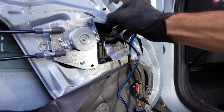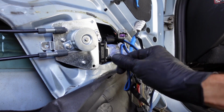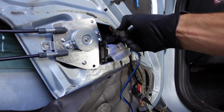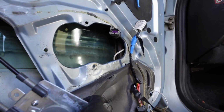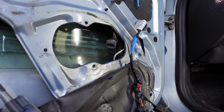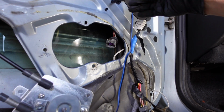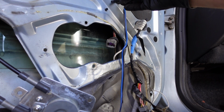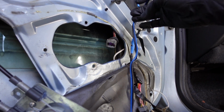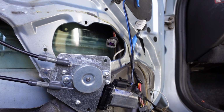Your wiring, you haven't got much to play with here, and you need to wire this in, which is plenty of wire, I have to admit. So you probably want to wait to put your motor in until you've done that, so you've got some space. You could do it with clips, you could do it with twist and tape. It's your choice, really. I am probably going to solder it in because it's nowhere near a heat source like an engine or an exhaust. So cut to frame of me showing you that I've just soldered that on.